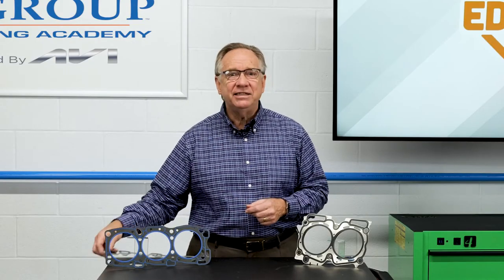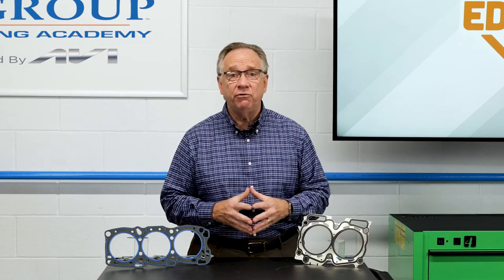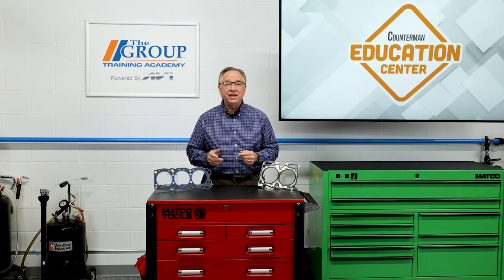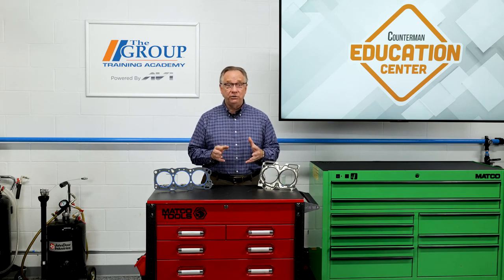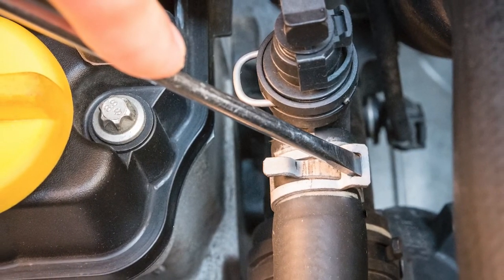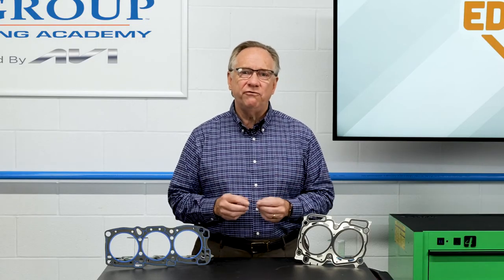Why would you remove an intake plenum and leave the old thermostat gasket in there, just so it can leak or fail and cause a repeat repair in several thousand miles? Not a good idea. Same goes for hoses — they all have to come off. Think of that typical hose removal tool: shove that between the metal outlet and the hose and poke it around. Think that's stressing that hose that's already well used? You bet it does. Then there are the hose clamps. Would you chance a major engine repair costing over a thousand dollars to a couple of two-dollar clamps? Not a good idea. Just think of all the things involved in a head gasket repair — be sure you are suggesting all those.